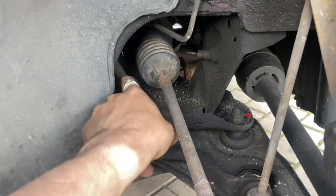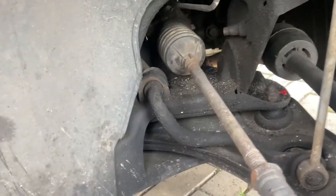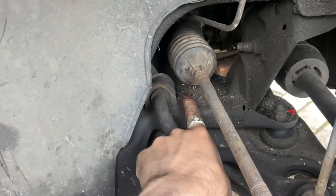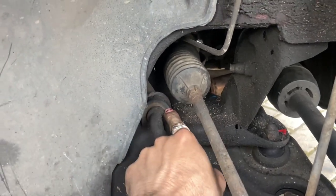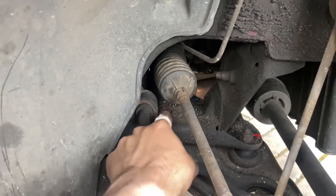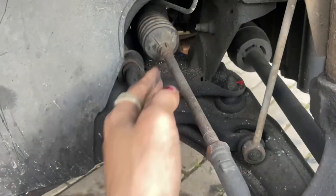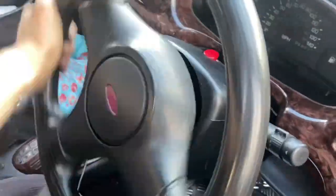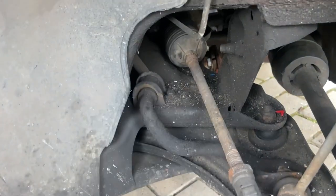On Escorts these are not a pain to replace, but they're a lot harder than the manual says - though they're not hard at all to be fair. All you've got is two bolts, one there and one there, bracket lifts off and the bush comes out. You can't get to that front one because the steering gaiter is in the way, so just turn your steering full lock to the direction of the wheel you're doing. We're doing the right wheel, so turn your steering full lock to the right, and that will pull that steering gaiter in so you can access that front bolt very easily.